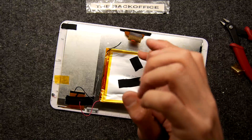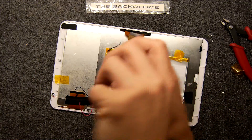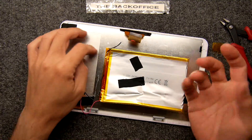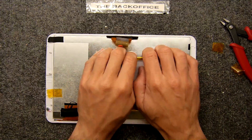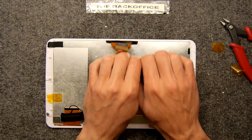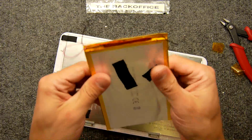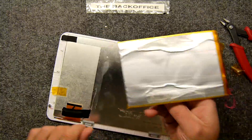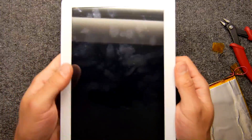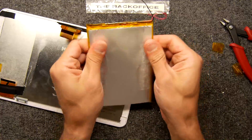You know you're not trying to save the battery so it doesn't matter. I'll show you sideways — I'm doing little fingers, just keep working them underneath. I tried with a scraper once and would punch at the battery, but this is way more effective. It's like you're bunching it up with your fingers — pulling, pulling. Brilliant! Battery off, no damage, screen perfectly intact, no cracks, no nothing.